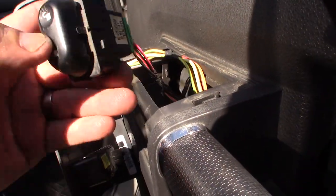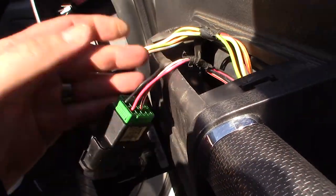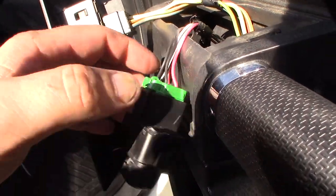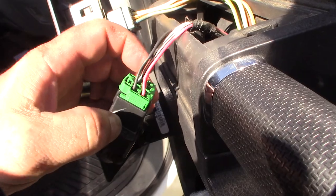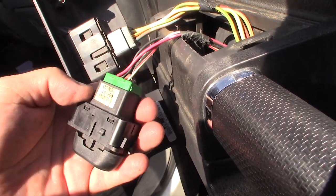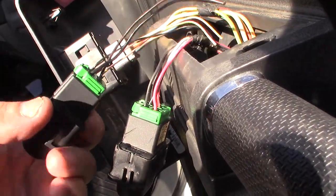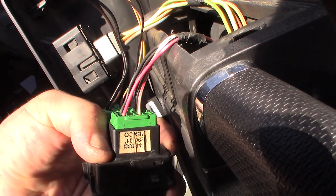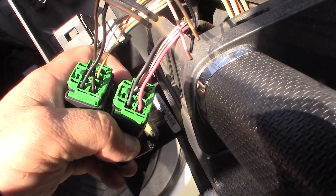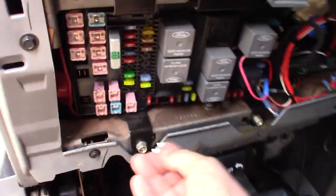The guy left the connector on this side, so I can just hook up the switch — and it actually did work. I think I need to have both hooked up, since I'm troubleshooting the body security module, and I should have the locks in place the right way. If it thinks it's compromised, it's never going to go to sleep mode. The color coding is a little different, so I'll match it up. Putting the body security module fuse back in.